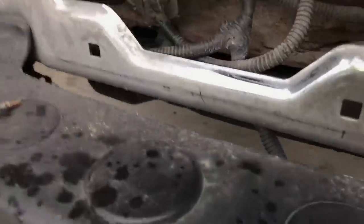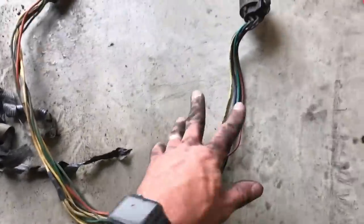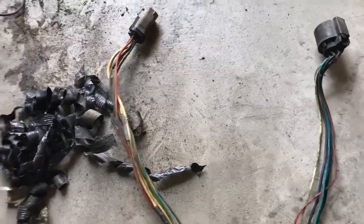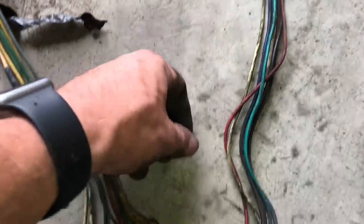I took the license plate off for better access to the wiring in the back. There's another connector for the trailer light wire harness that you can unplug — this gray connector here that disconnects from the gray connector off to the left, which is the connector for the trailer wiring harness. I pulled this harness out of the truck. It was all wrapped in a wiring loom with lots of duct tape on it. I noticed some unusual bulging in the wire loom and lots of excess tape, which made me think somebody had done something to this wire harness. Sure enough, this red wire right here is the trailer left-hand turn and stop circuit.